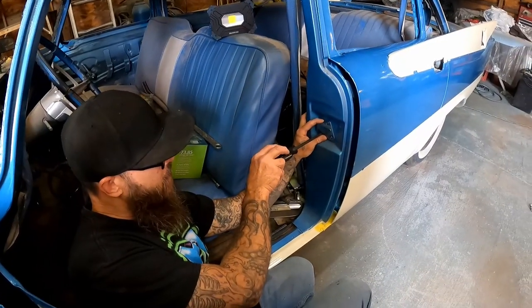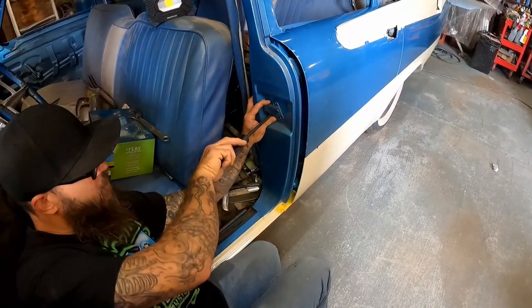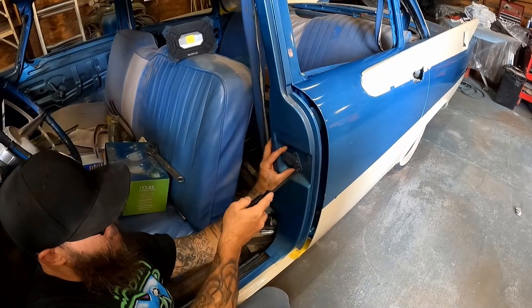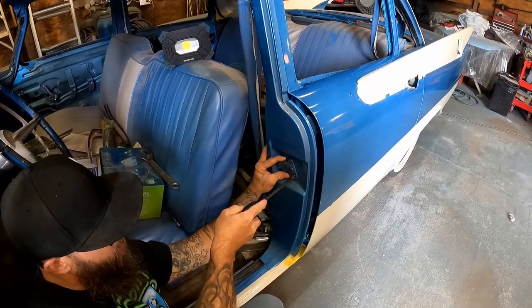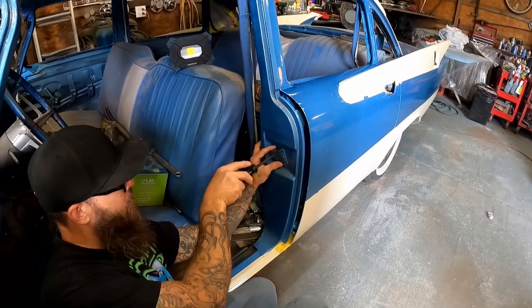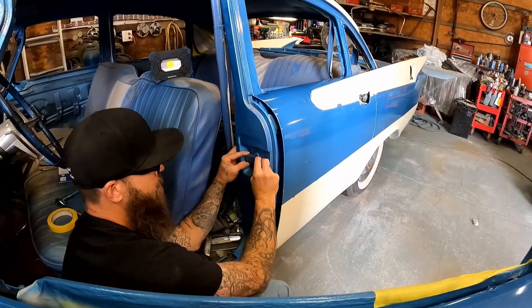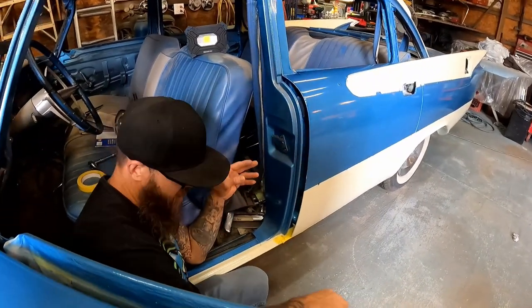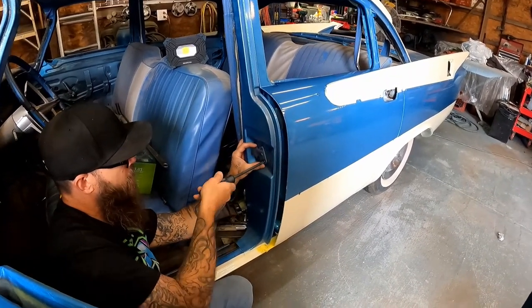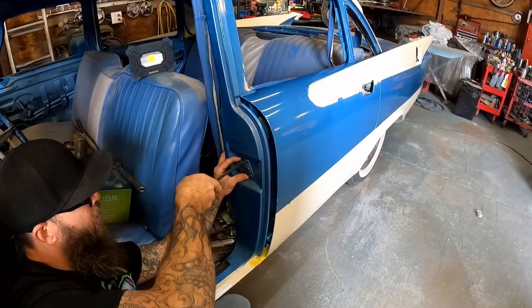Just like on the back latch striker, all I did was barely tighten it to the point where it just stops moving around. That's all I want to do — get it to where it just kind of stops moving when you're messing with it, because at first it wants to go all over the place. Now we've got it to the point where it's in place and will move if you make it move but isn't moving on its own. We should be able to shut the door and have this kind of line itself up.